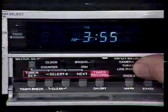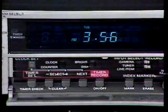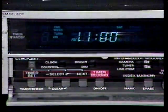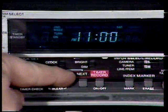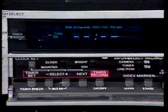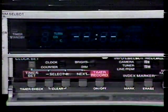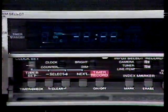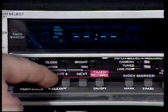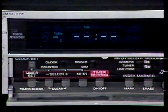On the secondary operating panel, press the timer set button once. The timer display will appear. Notice the letter flashing in the lower left-hand side of the display — the timer is asking you to select program A, B, C, or D. Press the plus button to go up and the minus button to go down. When you have chosen the program you want to set, press next. The days of the week will now blink. To record a program at the same time every day, press next. To select a specific day, press the plus button until the desired day is reached. You can even set a day in the second week — which always starts seven days from today.